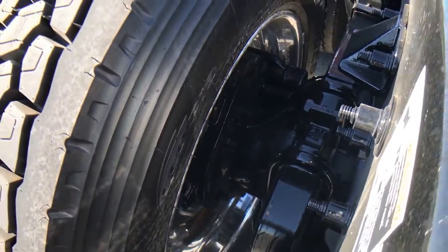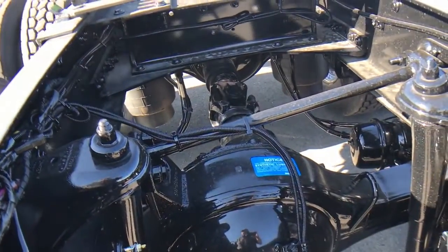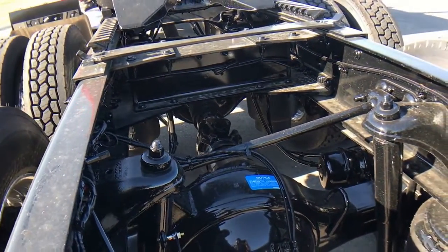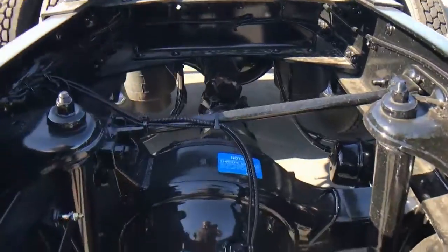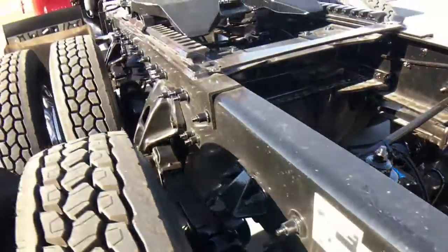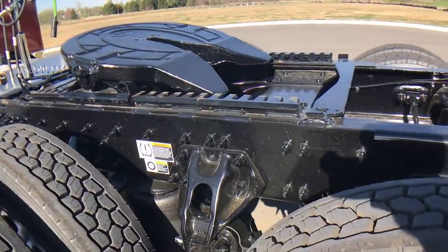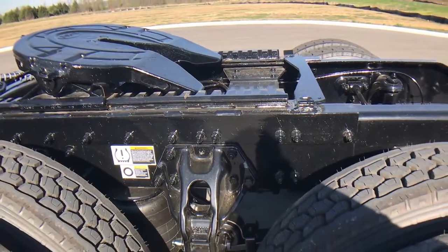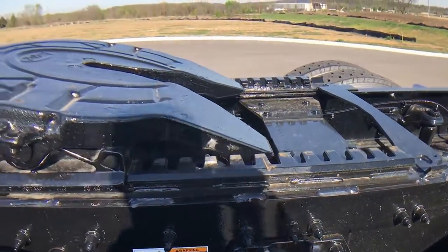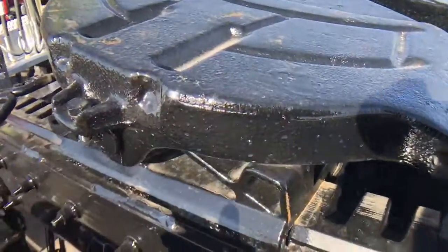Low air leaf suspension. 3-axle disc brakes, which I believe is one of the best upgrades you can get. It's a little bit of money up front, but you'll next to never put brakes on this truck. 336 rear ends. Holland FW35 fifth wheel with a 36-inch air slide. Depending on your application, this fifth wheel and leg setup should work for you.